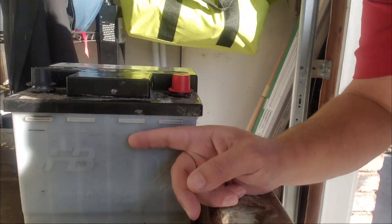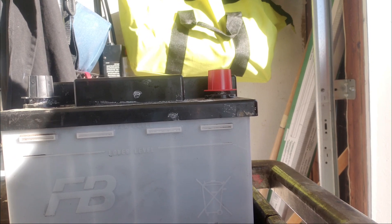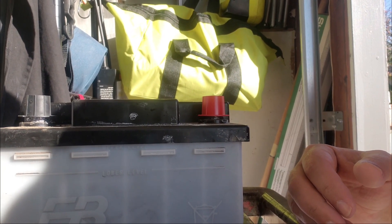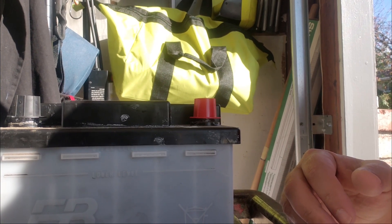Update: after about three months, the car didn't start again. When the weather got a little colder it stopped starting and the battery is no longer good. As much as I hate to admit it, it is not a permanent fix — it will work temporarily. I may try the wake-up method: hook up a very strong charger and cycle it five times for 15 minutes each, letting it cool for 45 minutes between cycles. Adding just distilled water and pretending everything's going to get better — not really the case. Thanks for watching, please leave your comments below.